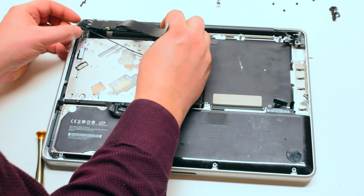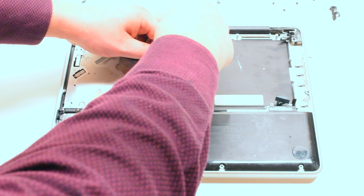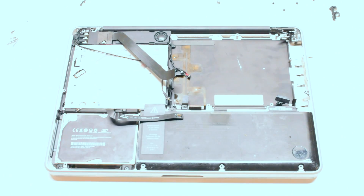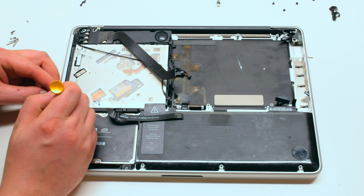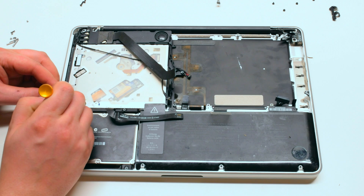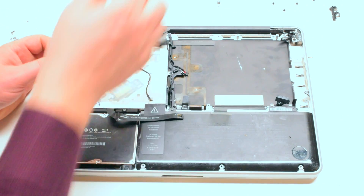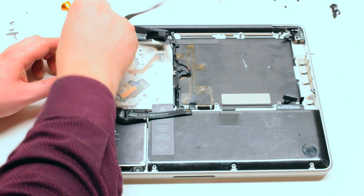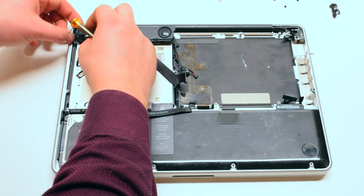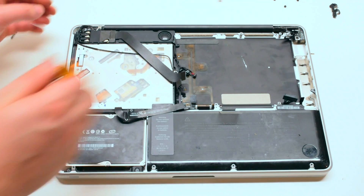Position the speaker on top of the DVD drive. Reinstall the DVD drive screws — one in the back and one on the bottom left. Using tweezers can help you place the screws back into their position as they are sometimes tricky. Pry up the speaker and reinsert the Phillips head screw in the top left side of the DVD drive. Put the speaker back into position, making sure to tuck in the antenna cables. Now reinstall the two long Phillips head screws securing the bracket.